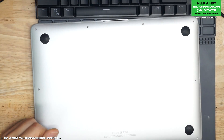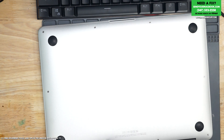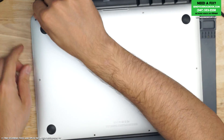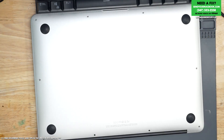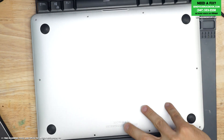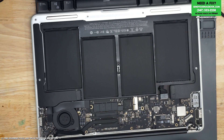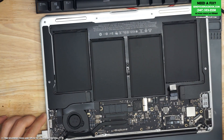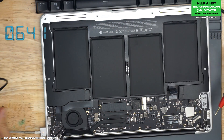We can open this thing up. So let's see what's going on with this MacBook. As with every other MacBook, we're going to unplug the battery, plug the charger in, and we're going to see what it's taking. So we're going to turn on our power supply software. It looks like this machine turns on - it does have a green light, and we do have fan spin.